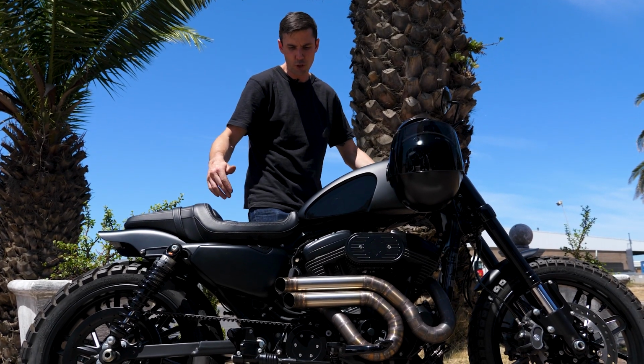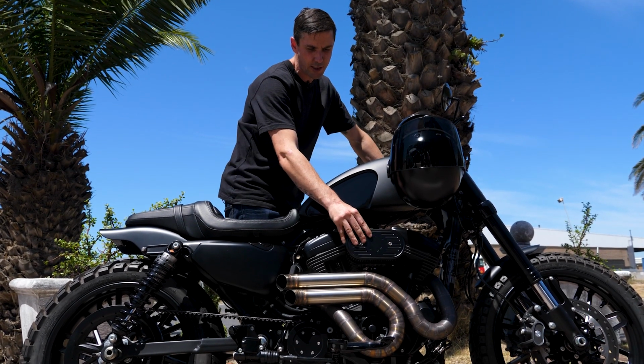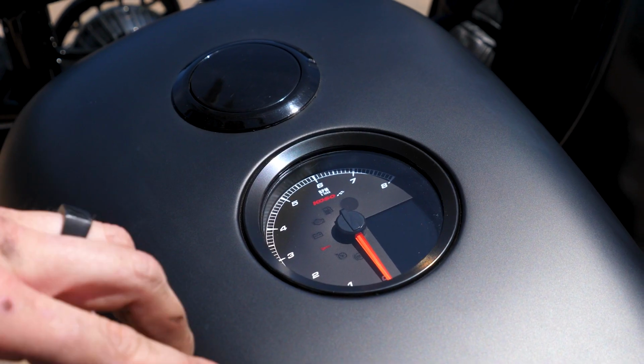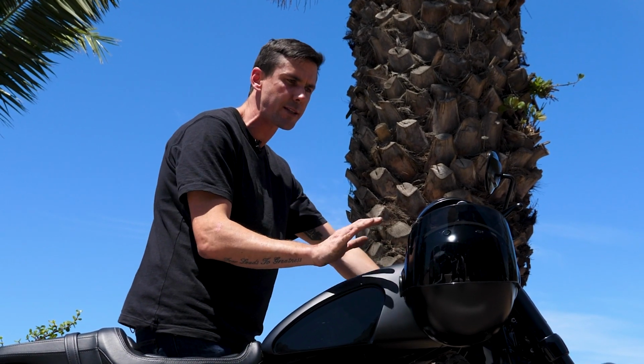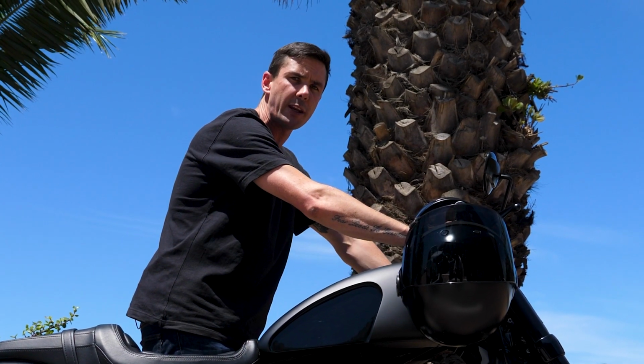So what we manufactured was the 316 stainless steel exhaust in-house. It's got the Stoos Customs bulleted air cleaner. A lot of work went into scalloping and sinking the dials into the tank, because we wanted to really clean up the bars for that Stoos clean custom look, with the turn signals and neutral lights incorporated into the bars.